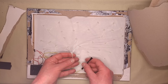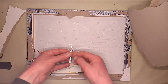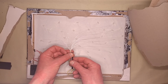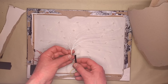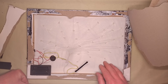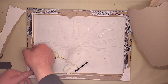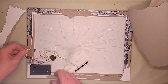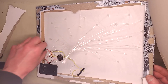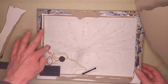That would be a sort of critical operation. It's taped here — there's a bit of clear sellotape around it. They've cropped the end, put them in and then shrunk it down. You wouldn't want to apply too much heat; I've tried that in the past and found it problematic because you can distort the fibres. So the fibres have been fed through from the other side and then blobbed in with hot melt glue. That's a lot of work. Here is the switch arrangement at the side — the little push button is down there, and they've literally just slid the push button in and then hot melted it.